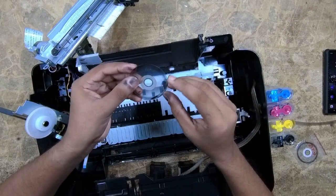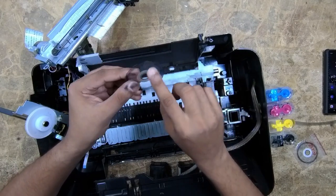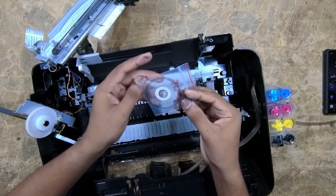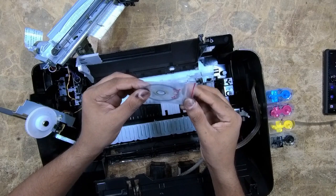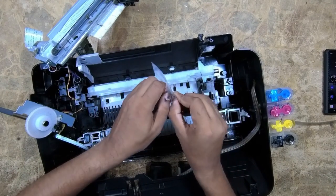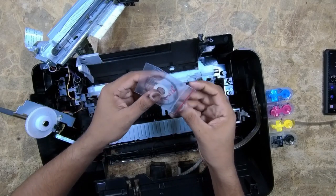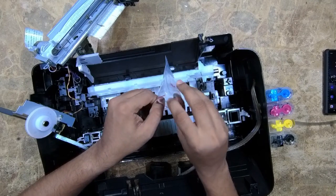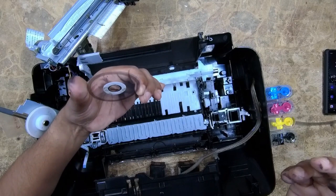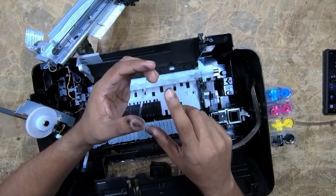You can see clearly that the encoder disk is damaged. This is the new encoder disk. Both have different part numbers, but the diameters and the sensor strips are the same, so it's not a big deal. Try not to bend this thin piece of plastic — you can see the magnetic stripes on this round encoder.